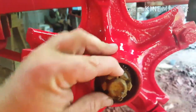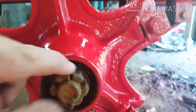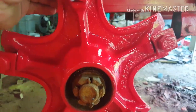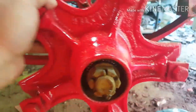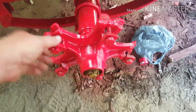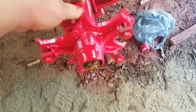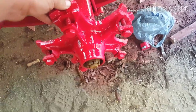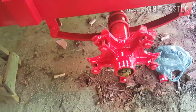But when you tighten it back up on there, you can tighten it up a good bit, find out where your hole's at, and back it off to that hole, and that's usually about pretty good. And then you sit there and spin them. But that's the way I was taught by my grandfather, how to pack old bearings like this, and then set the play in there. My grandpa and my dad. But that's that on that.